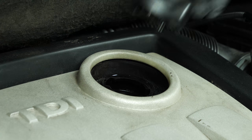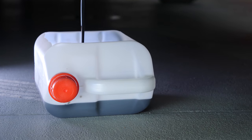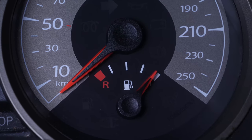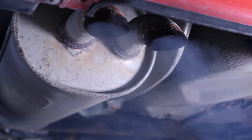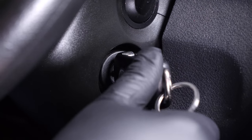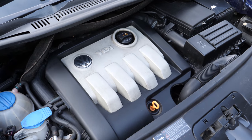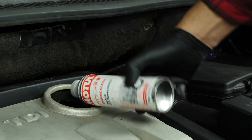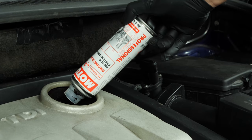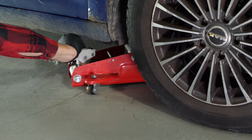Before draining the oil, we recommend adding a pre-oil change cleaner to the used oil. This will enable you to unclog your engine and get rid of any persistent residue, to reduce your consumption of oil and fuel, and to reduce the polluting emissions as part of a technical check-up. Before using it, start your vehicle for 5 minutes so that the oil is slightly warm. Then add the product and leave your engine turning over slowly for 10-15 minutes. Once the product has been added, you must not drive your car. Ensure that you change the oil immediately afterwards.